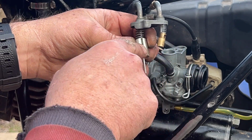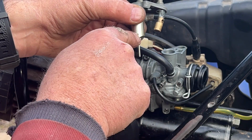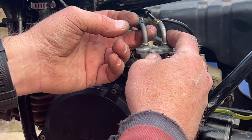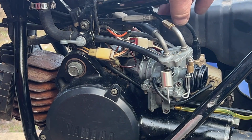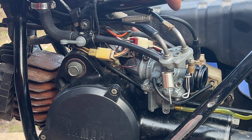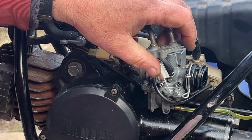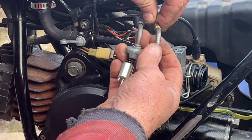Okay, so let's stick this back in. This is the guide slot on the side. There'll be a little pin in there, guide for this. That is the throttle ramp. So, oh no, oh no. Is that kosher or no? No, it's not. This is the secondary cable that branches off from the throttle cable, so when you give it more throttle, this pulls on the little lever in here and allows more oil to be injected in the injector. Yeah, I ran the choke cable over top of it instead of under it. So, get over. Get out of there.